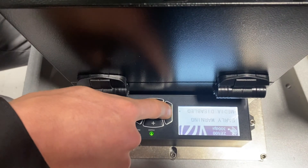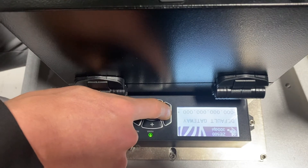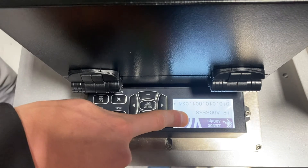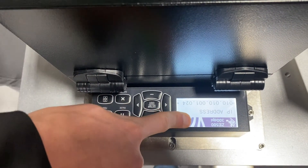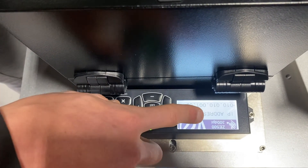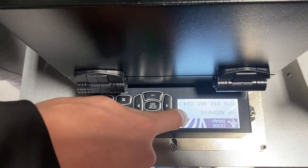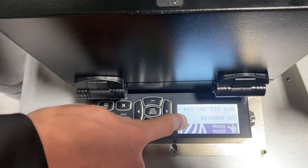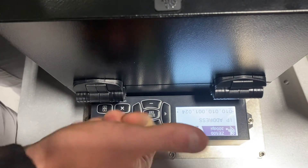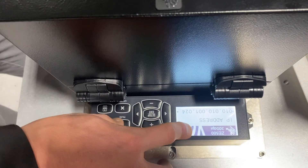The last setting I want to show you — going back towards the other side to the left — is if we're communicating via Ethernet, we're going to have to use an IP address. We assign an IP address to the Zebra printer so that it can communicate properly with the computer. If you do not see this IP address, it means that the printer does not recognize a valid connection via Ethernet from your host computer. That can mean the Ethernet cable's not plugged in, we've got a bad Ethernet cable, or the computer's not powered on — so just keep that in mind.